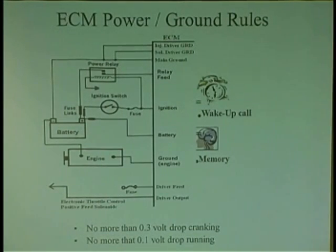Do you know a lot of the driver circuits now, where we thought they used to be ground controlled? Now the solenoid circuit is grounded, and now they send power out. Imagine that. They'll send power out. How'd you like to have a solenoid code on a transmission? And the guy checks the wire from the transmission computer back to the trans, and then he sends his own power, and he can energize the solenoid. So he goes, computer's no good. He puts a computer in, same thing, solenoid codes on the trans.